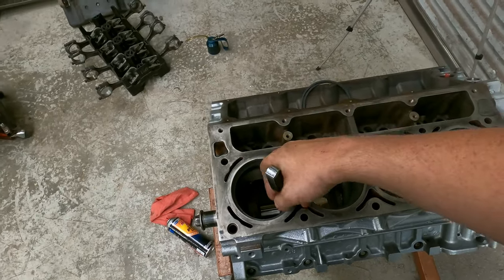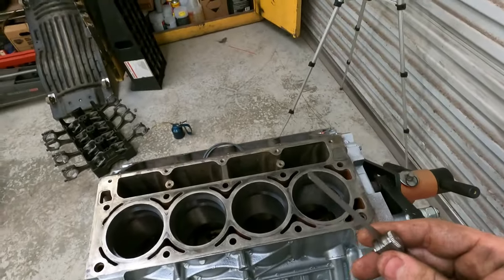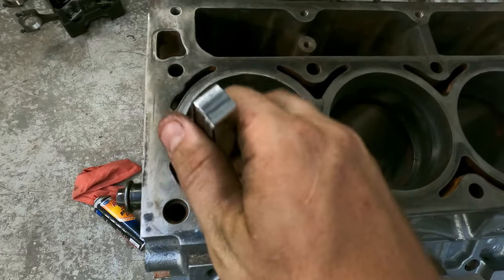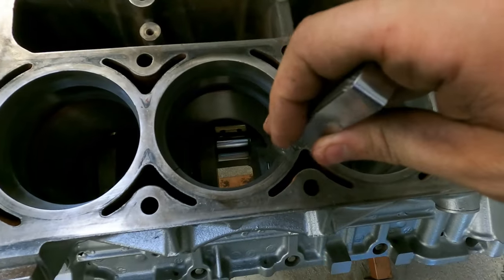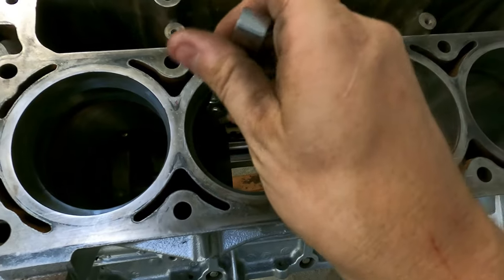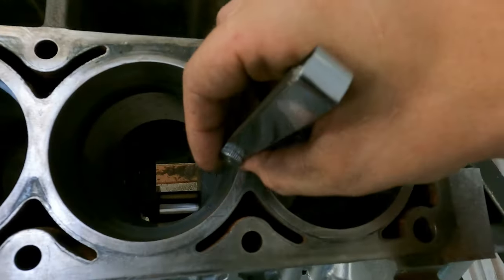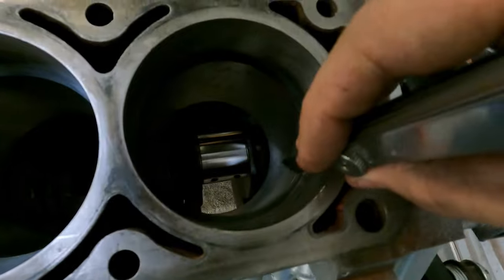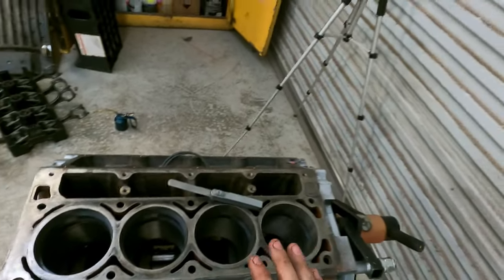Check this other one real quick. Oh, where's she at? There she is. All right, so there's plenty of room there. Let's check another one. Let's check it with an 18 or a 20. All right, so we've swapped to a 20. I think it's a 20. So let's see. Fits nice, perfect. Actually, same thing. 20 fits perfect. Let's check this one. 20 fits. Ooh, 20 is just a hair tight. That's okay because of the goal here. All right, now these two only put the second ring in, so you'll be able to see a lot better. There you go. 20 fits. I mean, absolutely perfect right there. And then a 20 fits absolutely perfect right there. So we know this side's good. Now, that's it. We'll call this good.